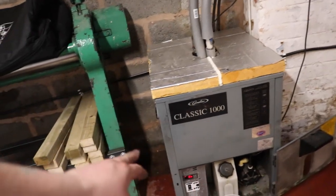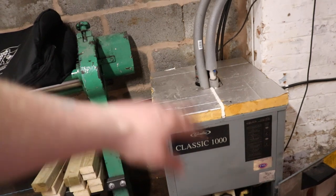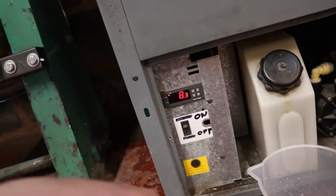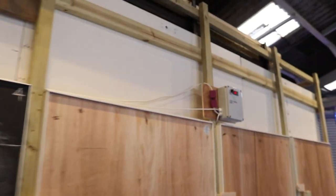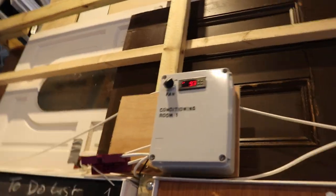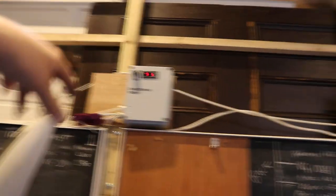The compressor pulls a massive ice bath in here, which I normally have set to minus five, but because we've got it turned off it's now at 8.3 degrees. The reason it's at 8.3 degrees is because we have everything running — all seven of these cold rooms are running. This one's at twelve degrees, this one's at twelve degrees, these two are balanced, and this one is at 9.1 degrees which is the hop store. They'll start to climb and balance at some point since we don't have active cooling going on.